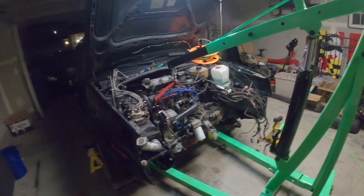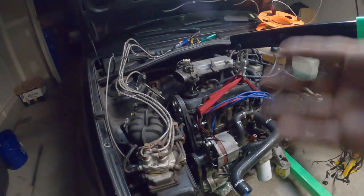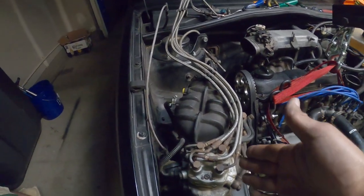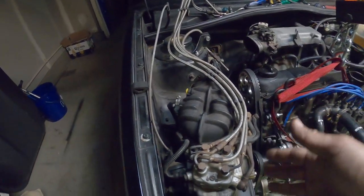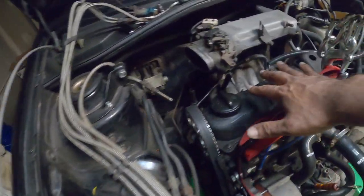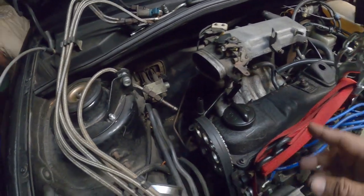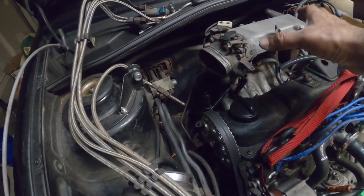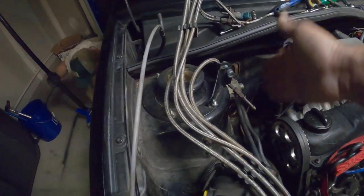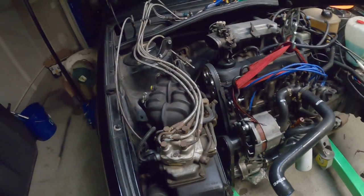All right, we're back. Like we said earlier, we're gonna disconnect a bunch of stuff. We disconnected the fuel injection system, the CIS. It's all disconnected: all four injectors and the line that goes to the manifold. We took out the solenoid that sits right here, and unplugged the O2 sensor and the two wires back here, and that cleared out the left side.